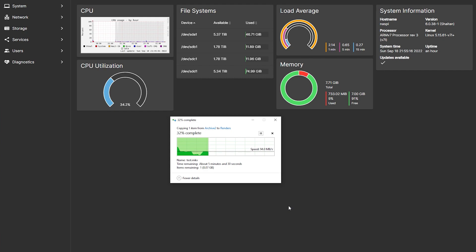There is one thing we have to talk about: all four drives are connected to a single USB 3.0 port. In theory that port has a bandwidth of 5 Gbps, which is more than enough to saturate all the drives without any problems. However, that's only on paper. In reality the write and read speeds will differ, and that bandwidth won't really be available because of CPU limitations — they will provide another bottleneck to keep in mind. The peak would still be around 110 megabytes per second, but it would depend on the drives actually involved in the transfer.